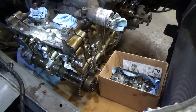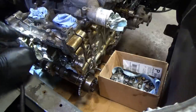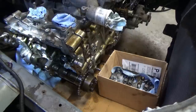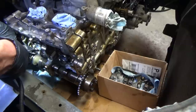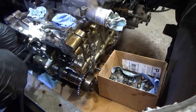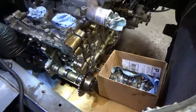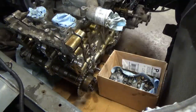Let's see if we can sneak these rocker arms in here and make them stay — this might be a little tricky. Using a magnet, we position the rocker like so. It fits very nicely but it will fall down, so we need to bring the carrier in a bit. We can do that by tightening up the bottom bolt, or by spinning the cam so the lobes actually hold up the rocker — at least on that valve. That works pretty well.